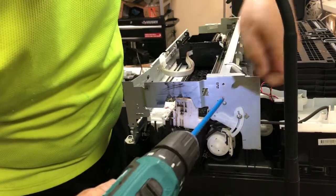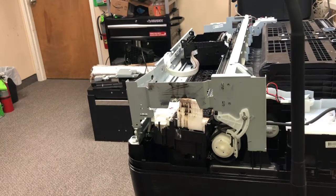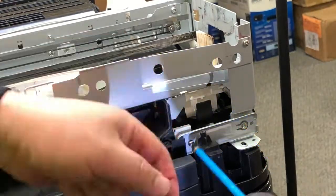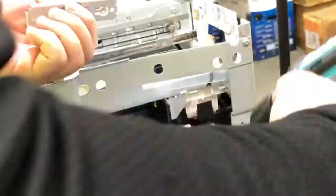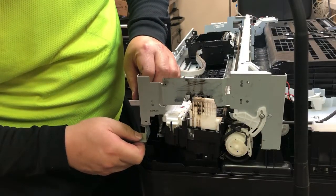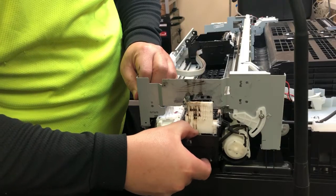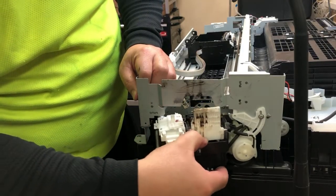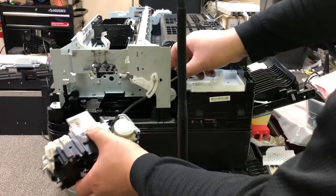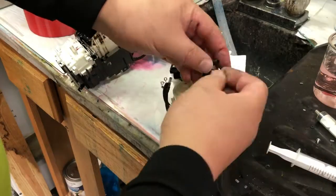On the side, remove those three screws. Look at the one that's straight down — it's easier at this angle. Don't remove the screw with the white piece. On the front side, remove all the visible screws. There's one horizontal plate you can take out, then the whole thing comes loose. Do not remove the side plate — just lift it up a little bit. You can gently slide the waste assembly out. This is why we removed the white lever and spring beforehand, because when you jiggle it you might lose them. We're going to salvage the long tube and put it on the new waste assembly.